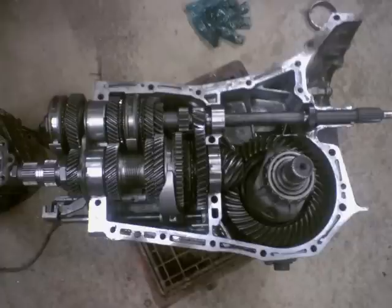Other than that, it's pretty much a straightforward mod. You will need to pick up a 4.44 rear end so your transmission differential and your rear differential do match. You can do this mod if you want quicker out-of-the-hole times or just a closer gear shifting pattern, but it's definitely a cost-effective mod compared to the alternatives. Hopefully it helps some people out.